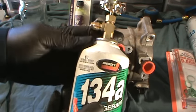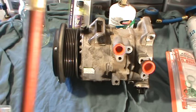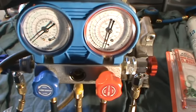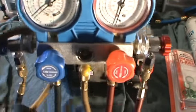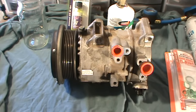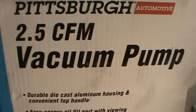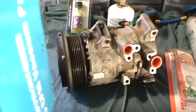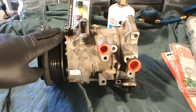All you really need is — you can buy the cans like this and you can buy the fitting that attaches to the AC gauges. So I'm just kind of giving you an idea of what you need if you really want to work on your AC. This is probably about 40 bucks. You hook it to the high side and low side, then the yellow side you hook to the vacuum pump right here. You get this vacuum pump — I don't know how much it costs, somewhere around one something. This is specifically for refrigerant. Item 98076 — that's just the Harbor Freight vacuum pump. I've used it several times. Anytime you open up the system, you want to vacuum out for about 45 minutes — I vacuum out for about an hour.